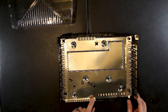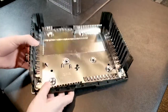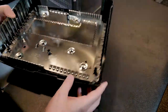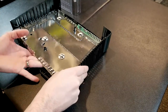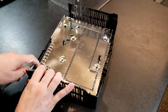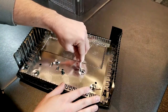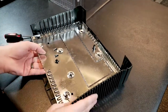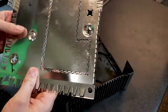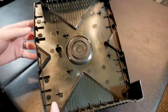The first thing you've got to do is remove the heat shielding underneath, and it's pretty easy. Basically what you need to do is just bend up these little crosses — the little flaps — and then they'll disengage from the little post that's under them. You can stick your hand under there, don't bend it, and pop off the rest. I've got a couple that are still quite attached so I'm going to stick a flat screwdriver under there and bend them up. There we go, it's out.